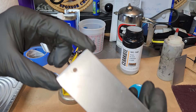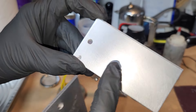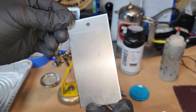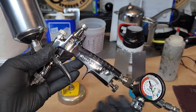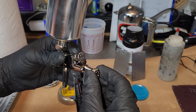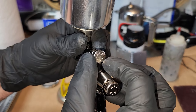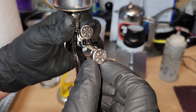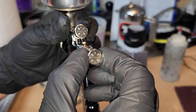Here's the acid-etched sample. I put holes in both pieces for hanging while we spray. On the second piece, the dimpled side mimics sandblasting using red Scotch-Brite, and the other side has no treatment. Now let's talk about gun adjustments — there are three. The bottom one is air pressure, which is wide open because we're using the pressure regulator. Then there's a fluid adjustment knob and a fan adjustment knob. For the fan, start at one turn out from fully closed. For fluid, do two turns out. We can adjust from there.